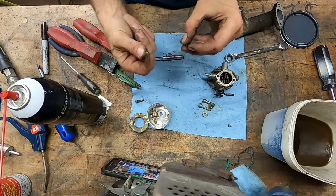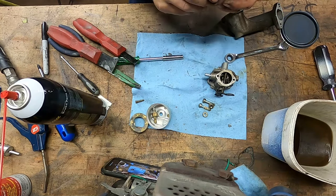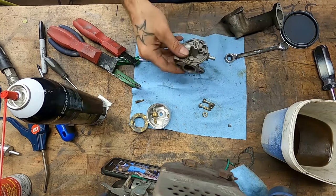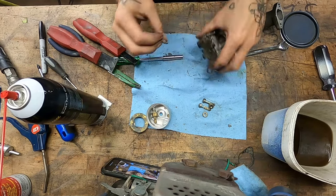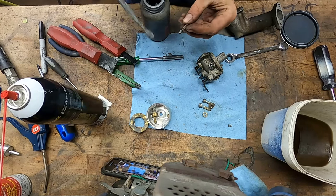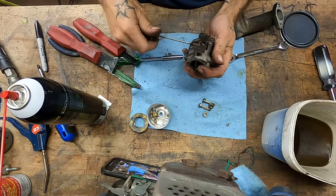See what we got. First thing, second, idle screw. Rubber seat, copper washer, spring, screw. Half, 1 1/4, because it wasn't running right. Idle screw, we're actually gonna put a little bit of anti-seize on that. Ironic given the motor, I know, but we're just gonna use an appropriate amount in a place that makes sense. How about that? Anti-seize, because this thing's gonna sit outside and those screws do seize up.